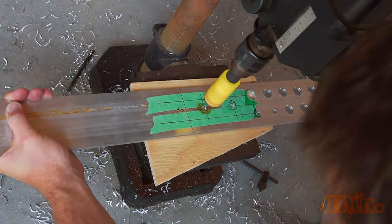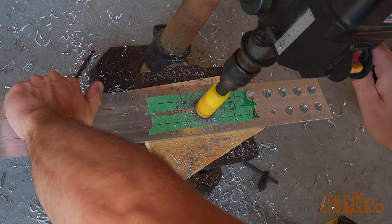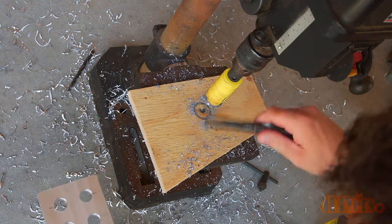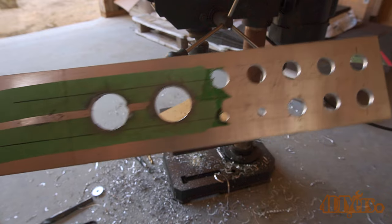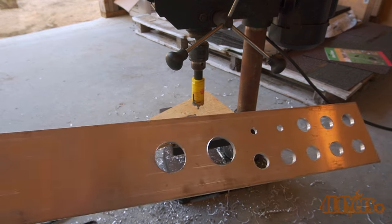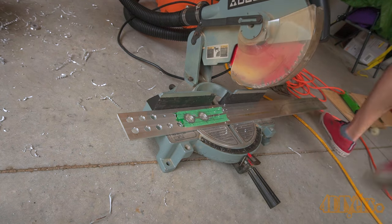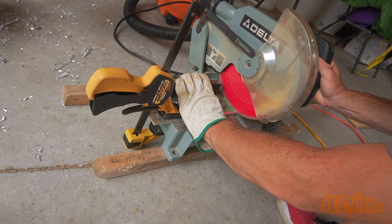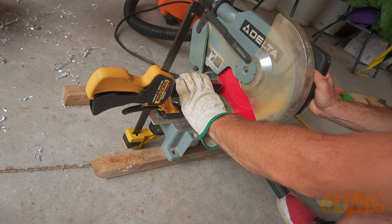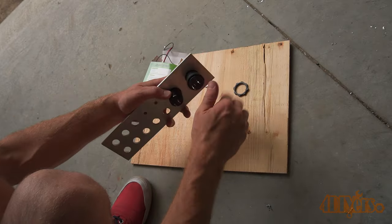While this isn't part of the RGB lighting, I'll show you how to cut the larger holes. For the USB charging and 12V auxiliary ports I used a hole saw — take your time and apply cutting oil. This method produces a great quality hole and can also be used in steel with a good quality hole saw. After cutting, burrs are left over and can be cleaned up with a file. To cut the aluminum to size this is done on a miter saw with a carbide blade. Candle wax is applied for lubrication, the part is clamped so it doesn't slide, and a vacuum traps most of the aluminum shavings. Apply light to medium pressure and take your time. A file is used to touch up the edge and a test fit is done with all the accessories.